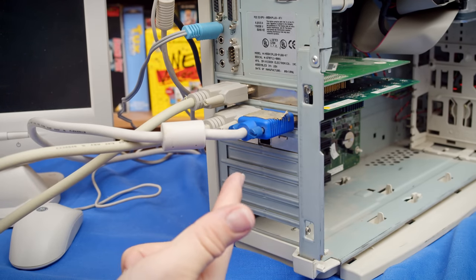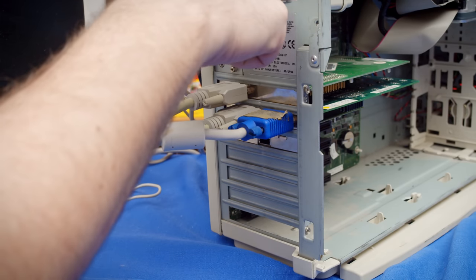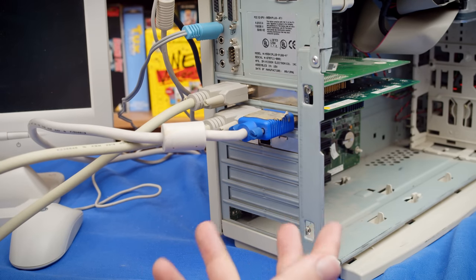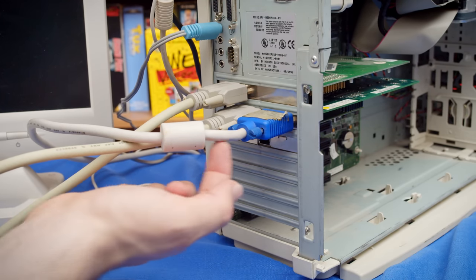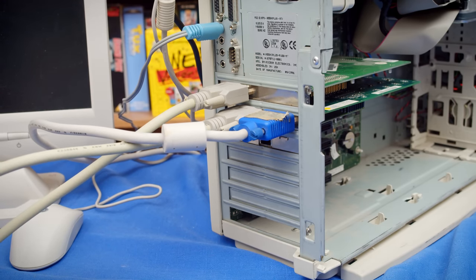When the 3D portion is not active on the Voodoo 1, that Gendac chip will actually pass through the S3's output directly. Then, when it switches to 3D mode, it will disable this and output only from the Voodoo on here. It's somewhat of a misconception that the Gendac chip allows the Voodoo to overlay 3D graphics or underlay. It is an either-or situation.